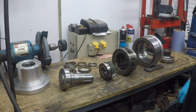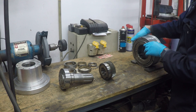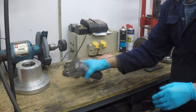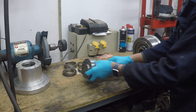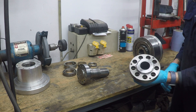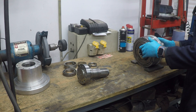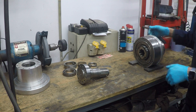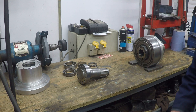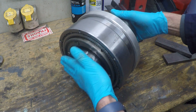The overdrive consists of a planetary gear set with a 2.6 to 1 step-up ratio. The planet carrier goes inside the annular gear like that — this is the output — and this is the output shaft which drives the transmission. That goes inside that gear and there's a bearing housing at the back to support this output shaft. This is the input shaft from the engine; the back of the crankshaft on this engine has a spline that goes inside the spline here to drive the planet carrier, and basically as the crankshaft rotates, that output shaft goes 2.6 times faster. There's the crankshaft input turning there, and there's the output gear.